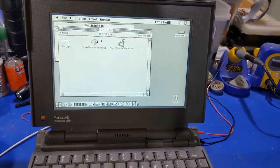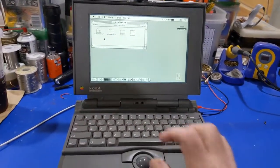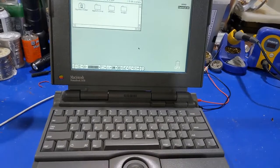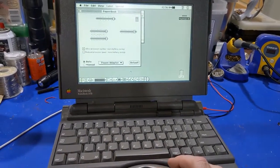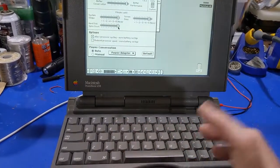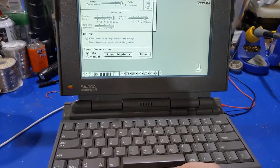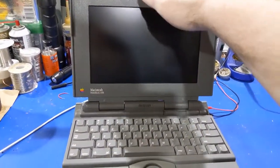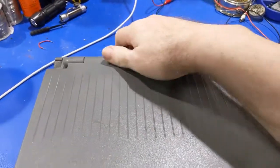She's all back together now. I kept the slot cover from the old battery — the original battery was bulging and leaking so that went bye-bye, but I did keep the slot cover. No problem with the plastics, everything's all good. I got my power supply rig in there and even got the rear door. System 7.5 is installed, which might be a little heavy for this thing because there's only 4 megabytes of physical memory, but it seems to work fine with some virtual memory loaded. The only thing I don't have in here is the PRAM battery — but that doesn't matter for what we're doing. I don't want the system to go to sleep or the hard drive spinning down because I think there's a bug with the BlueScsi if it spins down. I have it disabled and the screen dimming set. Thank you for watching — if you have a comment, please feel free to leave one, and until next time guys.